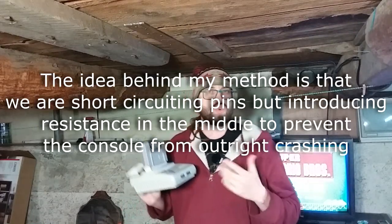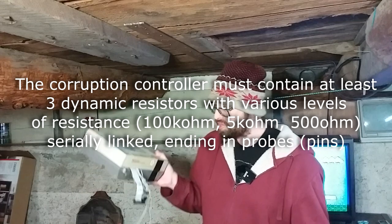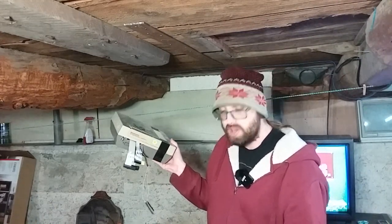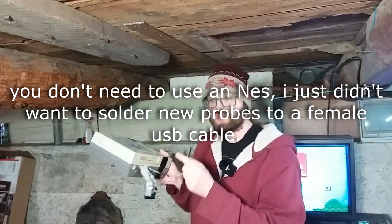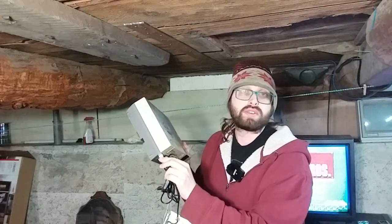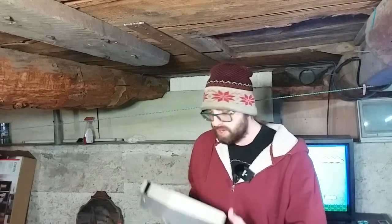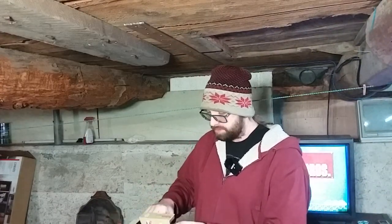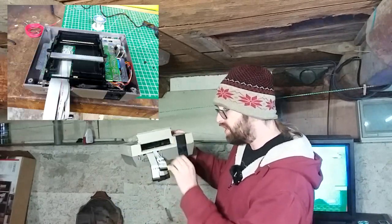What I've done here is created a thing that gives you an interface to somewhat short-circuit the pins of the cartridge. To do that, I've been using the Hardware NES Corruptor that I previously made — this is version 2, which exposes the CPU and the RAM in three different connectors. What we're using is essentially just the probes and the USB connector for the controller. The NES Corruptor is essentially just IDE cables making an interface to various chips on the PCB — I did solder the IDE cables under where the chips are sitting.